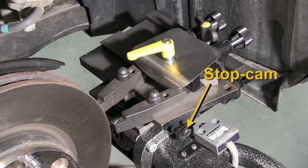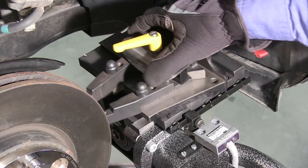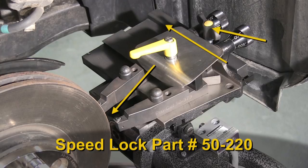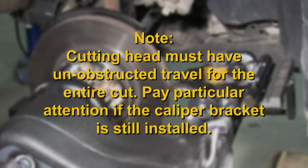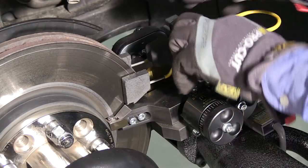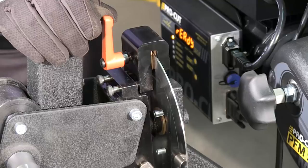Set up the stop cam by rolling the cutting tips in with the clutch knob to about an eighth of an inch from the outer edge of the rotor. Then loosen the thumb screw on the stop cam and slide on the rail until it is just to the left of the stop button on the micro switch. Next, center the cutting head over the rotor. For speed lock cutting heads, part number 50-220, simply slide, center, and lock using the lateral lock lever. For parallel arm G2X cutting heads, part number 50-1200 or 1250, slide, center, and lock using the lateral lock lever. Now select the correct position rotationally for the cutting process — where there are no obstructions for the tool arms to encounter and where there is enough room to install the correct silencer for that rotor type.